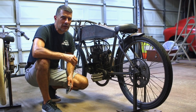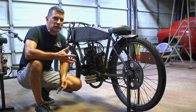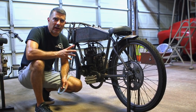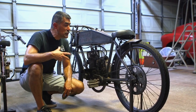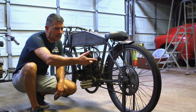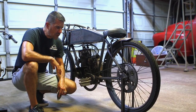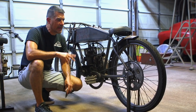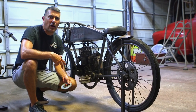This is the best ratio that has worked for us. I've seen guys run the 36 tooth on the rear — that gives you a much higher top speed, but it affects your takeoff. If you're going to use it as a race bike and want super high top end speed, then go with a smaller rear sprocket. If you're just going to be putting around the neighborhood waving at the neighbors, use something like this — it makes it easier to take off and still have the best of both worlds.